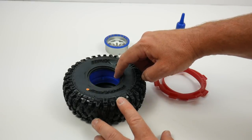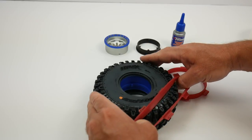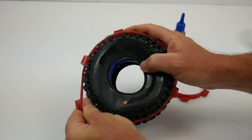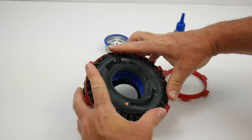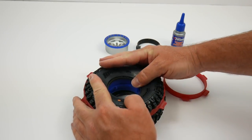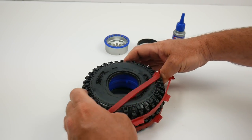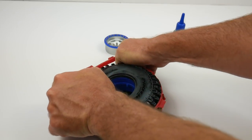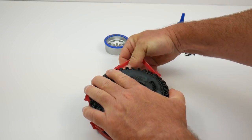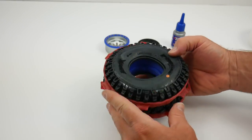Now that the wheel ring is inside of there, it's time to grab our tire bands. I've just found this useful on the Hyrax specifically. Different tires may vary — as I pull it off screen here to wrap the tire band around, what this is going to do is create a little bit of slack inside of here. So when you're grabbing that bead on the beadlock, it's going to go in there with no issues of it pulling out. This isn't a required item, but it definitely helps in the mounting of these Hyrax tires. They are such a large tire and the tire band just kind of helps that situation a little bit. Right there, those both are on now.